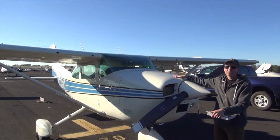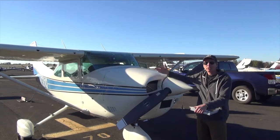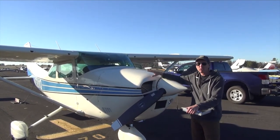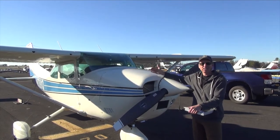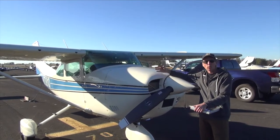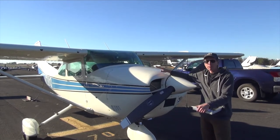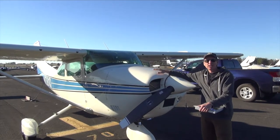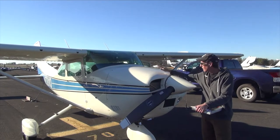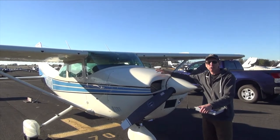In the past I talked about the Cessna 182 and the basics, also the cross-country flight. Today I wanted to talk a little bit about what's under the hood and some of the maintenance that an owner can do. Remember these are air-cooled, and oil is super important to actually help lubricate and cool it as well. So I'm going to change the oil today and show you how I do it. We'll take off the cowling — both the top part and the bottom part — this is something an owner can do.